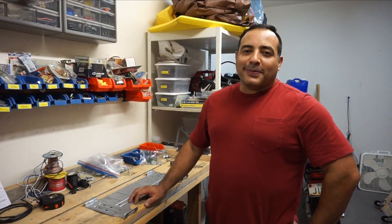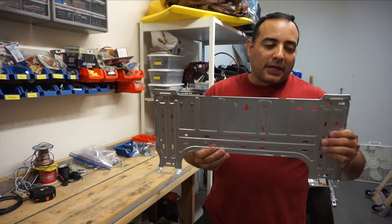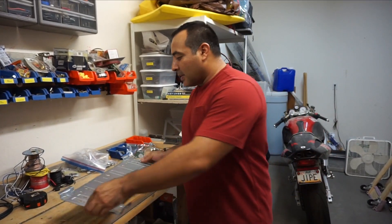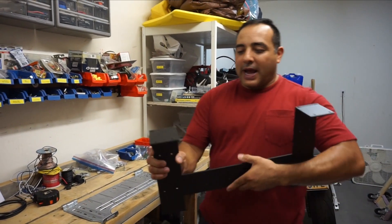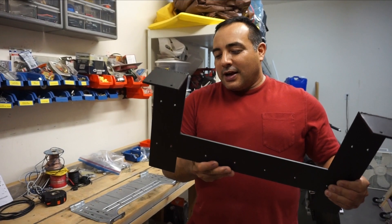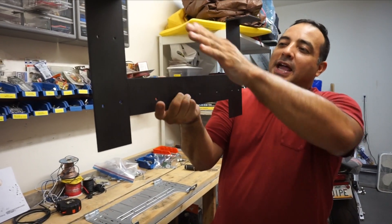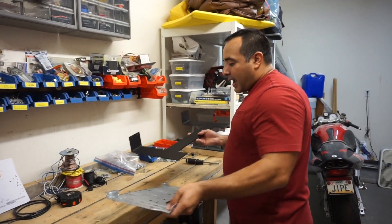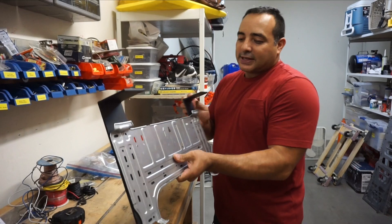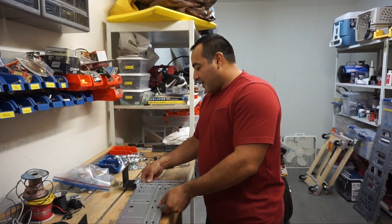Tonight we are working on the bus again. Today we're going to do the AC bracket. This is the bracket for the inside that our mini split came with, and as you can see it's quite flimsy and there's really nowhere to hang this. So we actually welded up a different bracket that's much more substantial — this one's made out of 3/16th inch steel that we then cleaned up and had powder coated. We're going to hang this in the bus where the sign goes, and then this bracket will fit on top of it. The AC will actually be hanging on this heavy duty bracket which is attached to the factory bracket it came with.